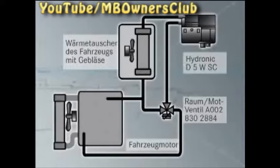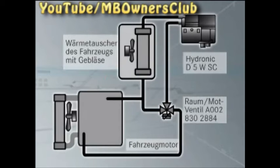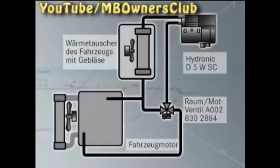These graphics show the function of both circuits. In the auxiliary heating operation, the control valve is operated and leads the hot water into the small circuit to the heat exchanger of the interior heating. The ventilator fan of the heat exchanger for the interior heating runs always on level one, regardless of which level you've set. This is an energy saving measure. When the set temperature has been reached, the control valve switches off and leads the hot water into the big circuit — first through the engine and then into the heat exchanger of the interior heating.